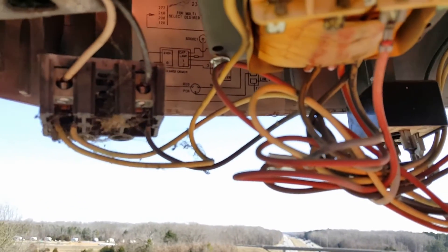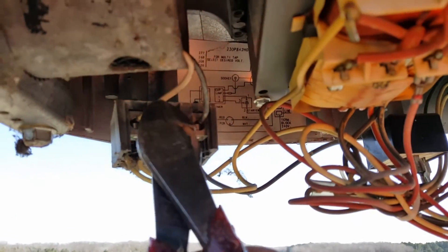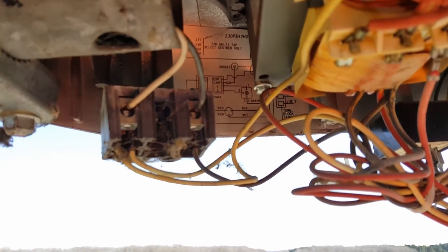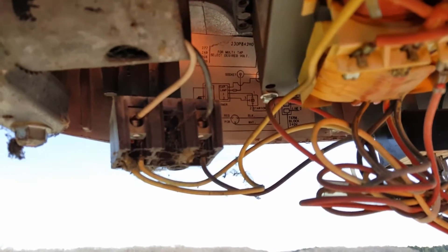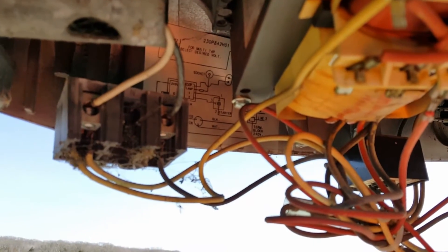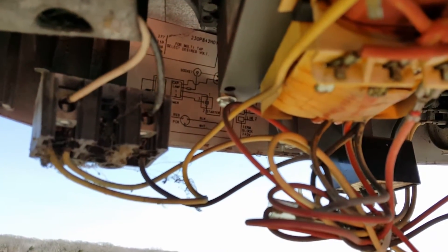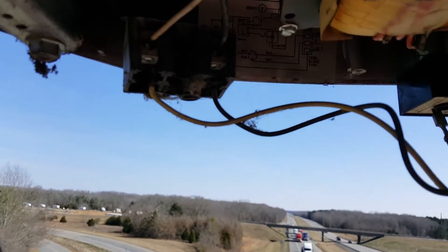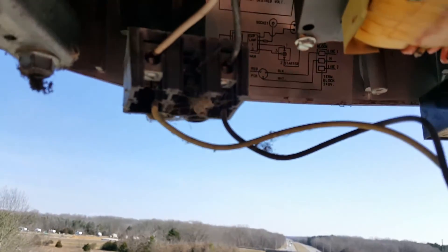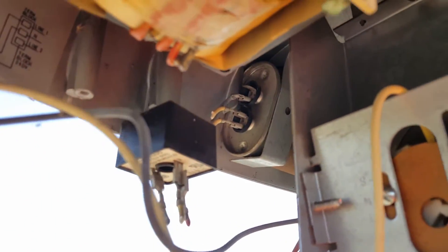Now the first thing I'm going to do is disconnect all my wires. I'm going to keep my two leads here — they're both hot even though one of them is white. It's not a neutral; it's 240 volt. I'm going to take the wires from the transformer and the capacitor and cut them all out of the way. You're going to leave your black wire and your white wire both connected here. Everything's cleared from the transformers and the capacitors — we don't have to take those out, it's no big deal.